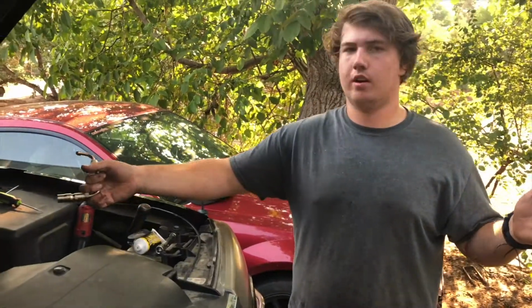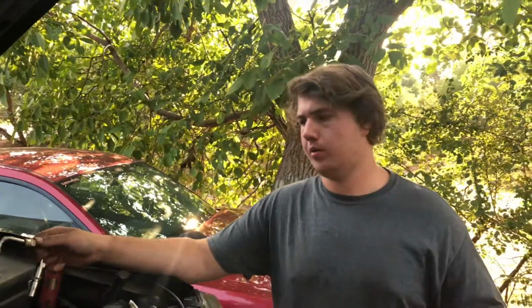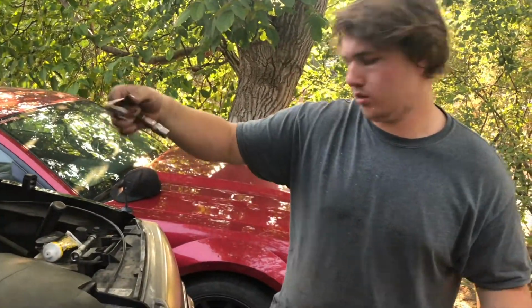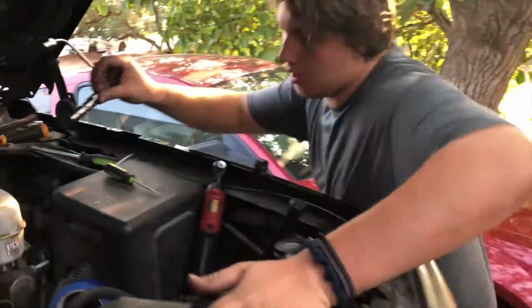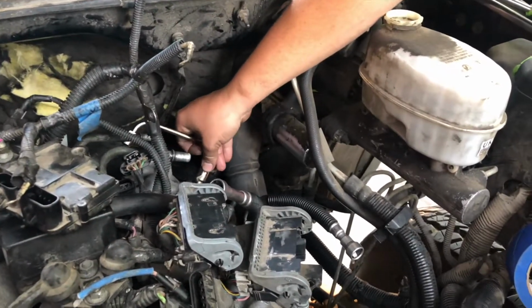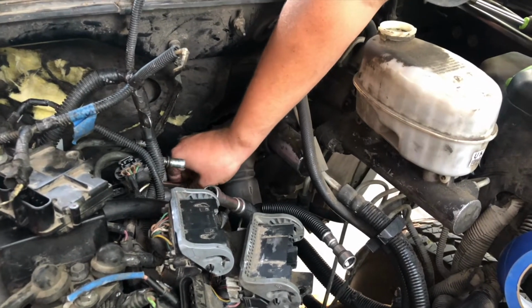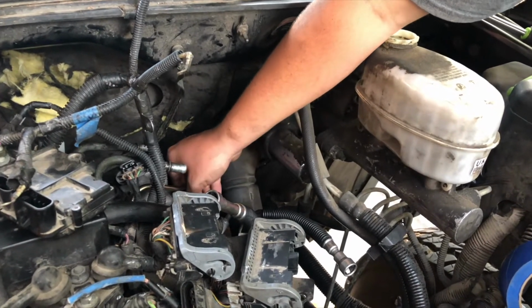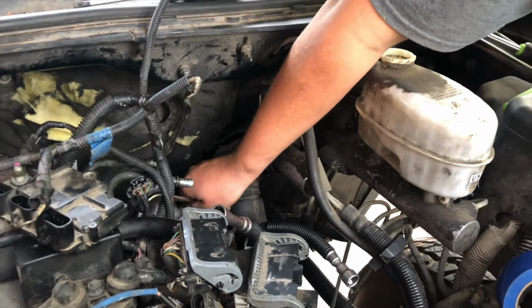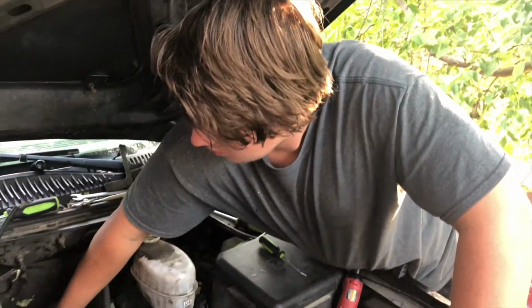The upper valve covers, lower valve covers we already did. I don't know if we filmed that or not, but we torqued the upper valve covers, and now we're putting on all of our new injector lines. So putting these on, and then we'll start putting all the brackets and stuff we took off back on it. And then change oil and fire it up. Start it. Change the fuel out of the oil, I mean, and then put oil in it.